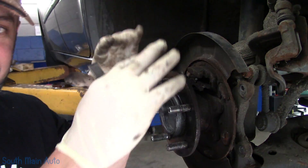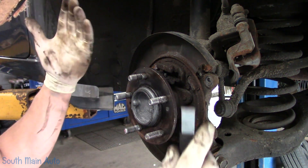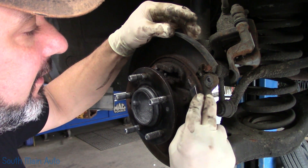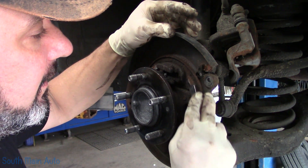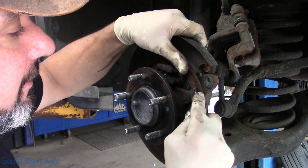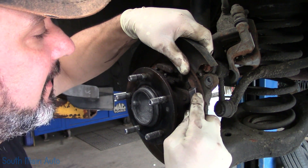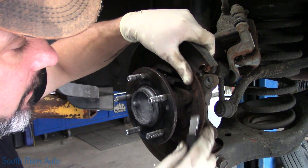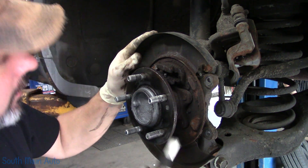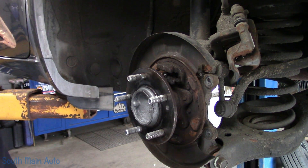What I'm going to do now — because he does have corrosion preventive measures done on stuff — I'm not going to get in here and whizzy wheel everything. I'm just going to take and clean off the mounting areas for the shoes and bust any loose stuff out of here. You want these nice and rust-free if you can, but mostly smooth. Looks like there are six mounting pads.